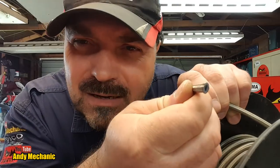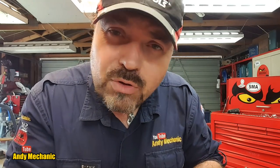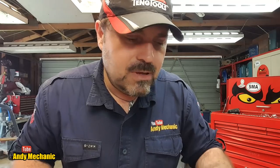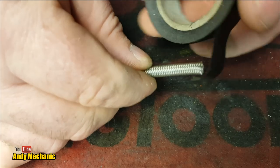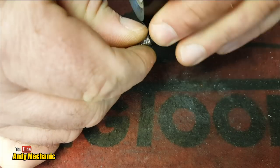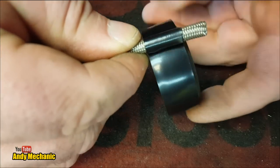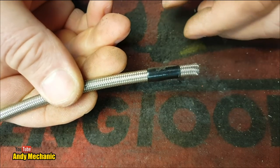So what happened to the pipe? It got squashed and deformed. The manufacturer's video was saying 'get some pliers and make it round again,' but the damage is already done — that pipe has been weakened. That's not the way to do it. What you need first is some insulation tape. Put it around the outside of the pipe — about three laps is ample.